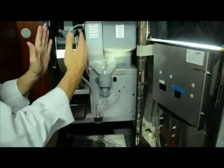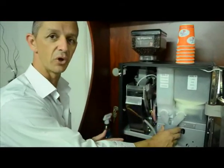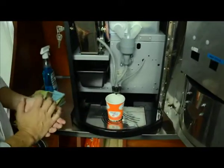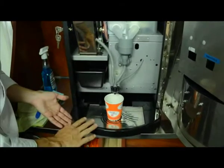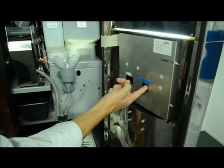On the inside of your Revolution and Evolution door you'll notice there are three buttons: a quick menu button, a programming button for Espresso Essential Technicians that customers never have to touch, and most importantly, on the right hand side, the wash cycle button. The red button inside activates the wash cycle, which gives the entire brewing unit and the mixing bowl a complete clean. Just press that red button when the machine is powered on for a complete wash cycle — it's a very important part of your daily cleaning. A lot of people like to take one cup to capture all the water rather than filling up the drip tray. Just reach inside the door, put your finger on the red button, and away you go.